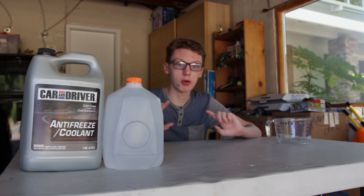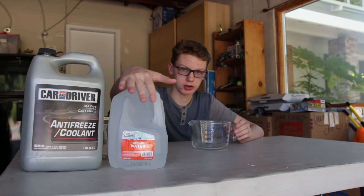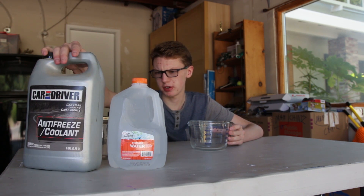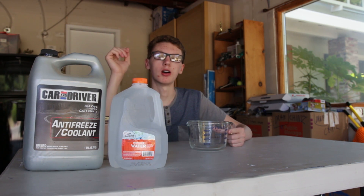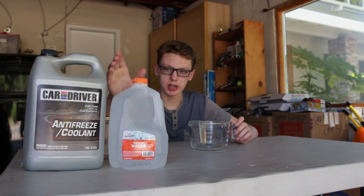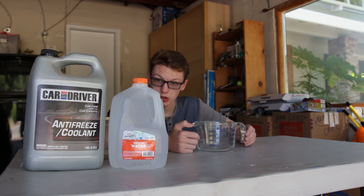So now it's the next day. Parts are still coming — they should be arriving this afternoon — but we're going to mix up our coolant while we're waiting. I didn't buy coolant because that adds to cost and you can make it yourself. I have antifreeze and distilled water and we're going to mix these together. The antifreeze helps prevent freezing and it's harder for stuff to grow in it than in distilled water. We're adding distilled water because it's very pure and we don't want any other chemicals in the loop like you'd get with tap water. We'll do about a 50/50 mix.